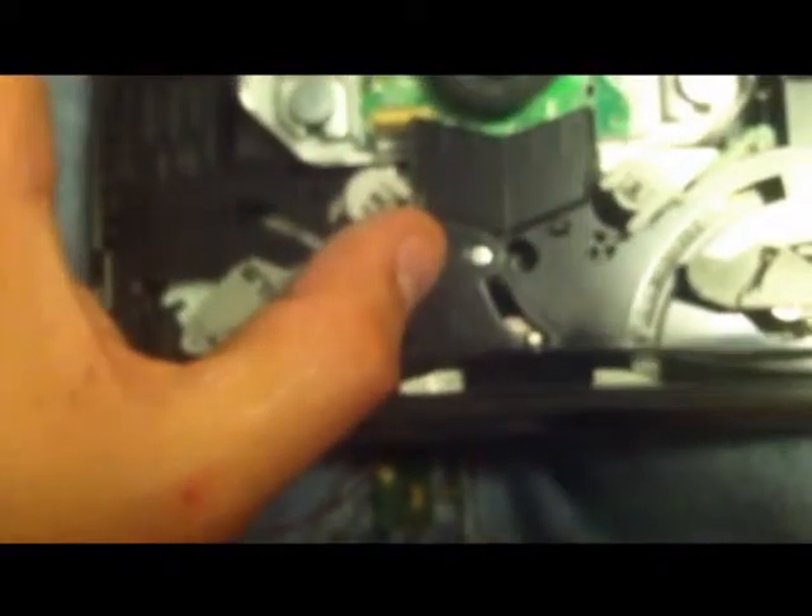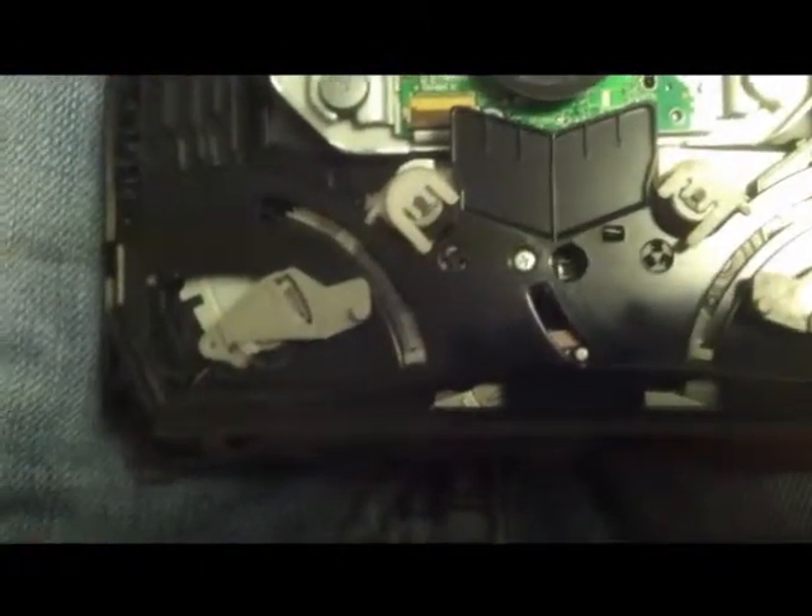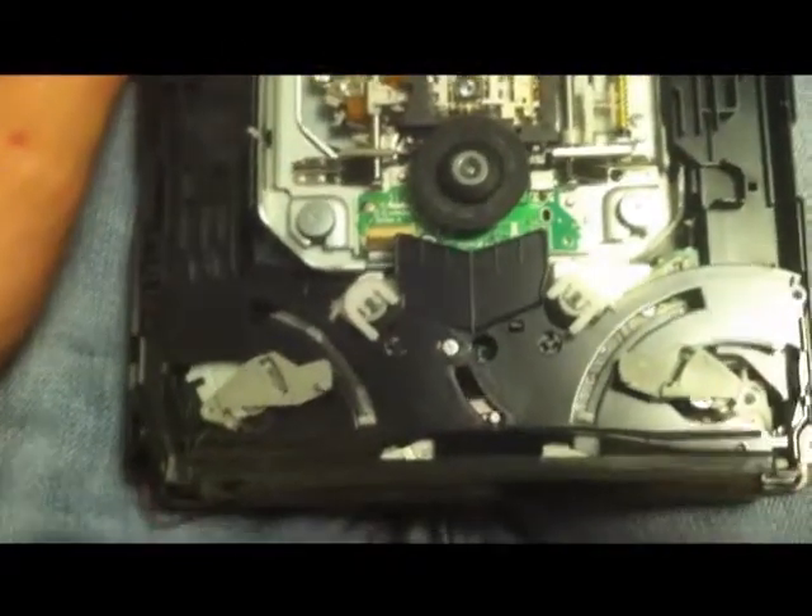Right there — middle one on the bottom is your ground, left is your DVD/PS2, right is your Blu-ray, which covers PS3 games too because they're Blu-rays. Then go ahead and put it back together. Make sure you be careful of this wire. When you put it back together, if you're having a problem getting a disc inserted — it pushes in just fine but it's not pulling — you pulled this wire too hard or it came unplugged. If it just won't budge, you'll have to take it out, pull the top rail all the way out, remove that screw, and while it's in your hand push this all the way back and let it hit. Then put it back together. Also be careful of the ribbon cable on the bottom — they're very fragile.